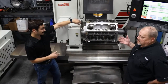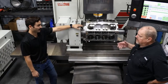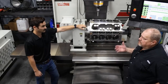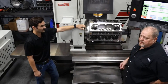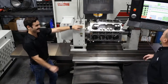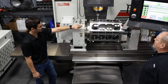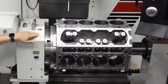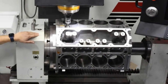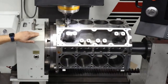One of the things the probe does is it takes four positions — basically twelve, nine, six, and three o'clock — and it gives you a diameter of the lifter bore itself. You'll see variances of a thousandth or more depending on the bore, just from the factory programming. And to collect that much data that fast is incredible about the machine. After this bank, it'll roll over and do the right bank also, so you get a complete basic print of exactly where everything is located.